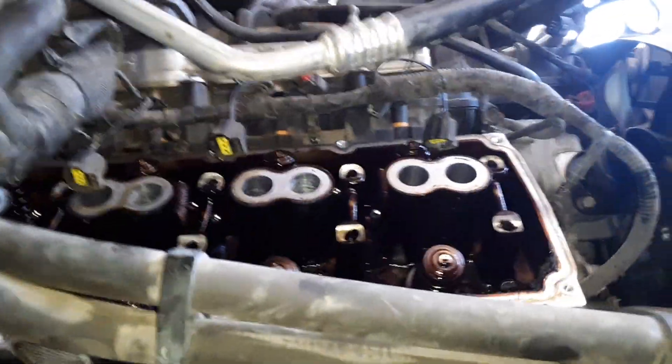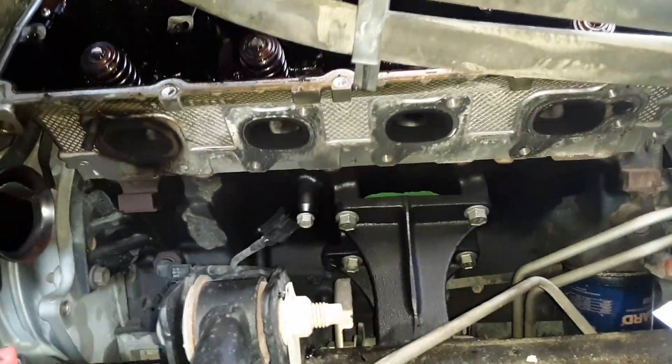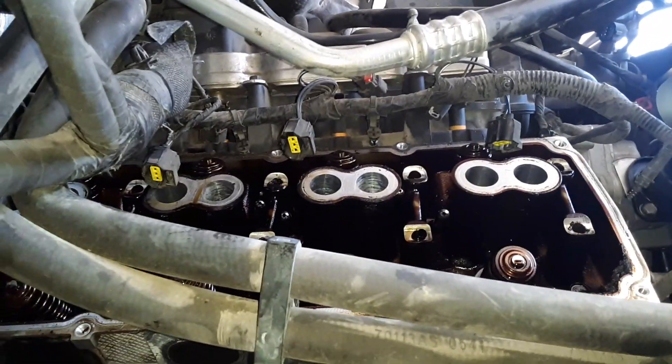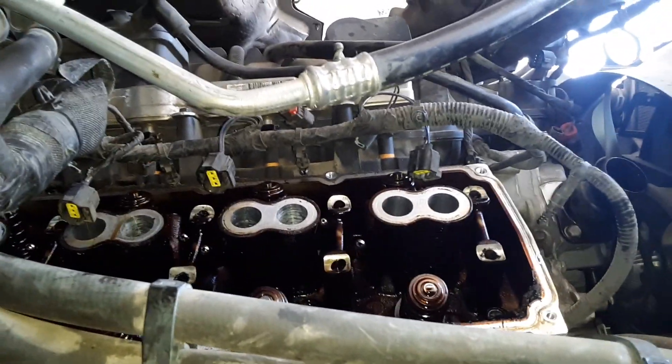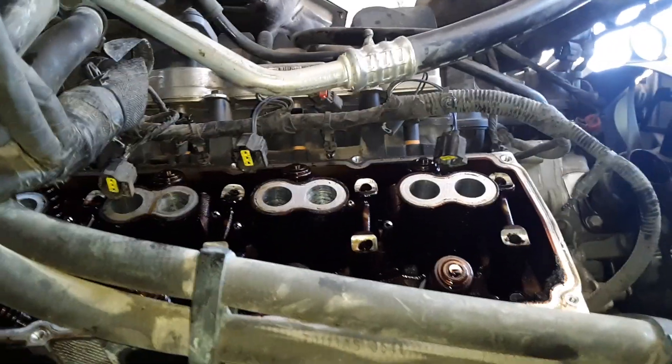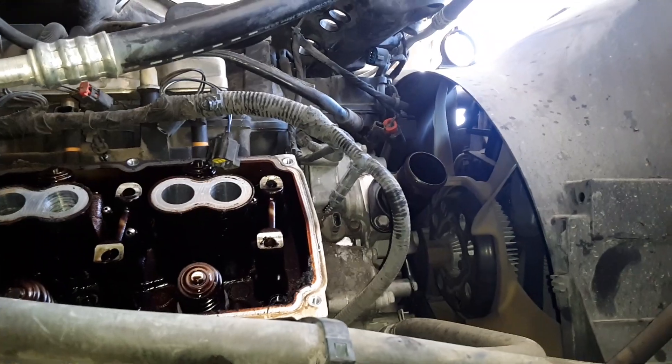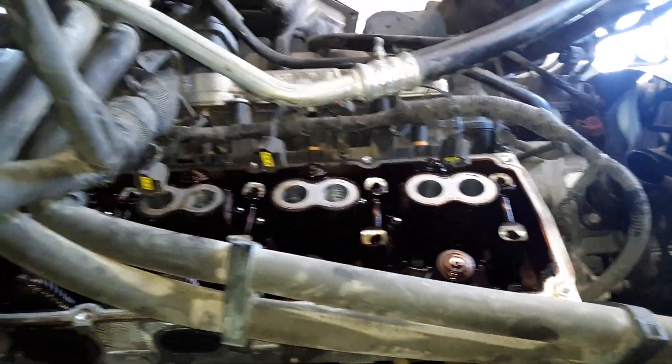Look at all this room I've got to work in here. I've already got the rocker arm assembly off, got the exhaust off, and I'm about to pull the push rods out. I need to make sure I keep those in order so the wear patterns stay even — all that good stuff. So yeah, it looks like it's official: I'm back to working on cars for a living.